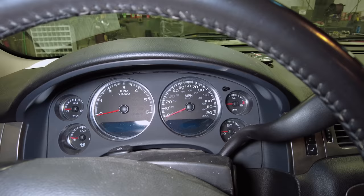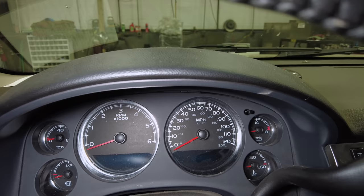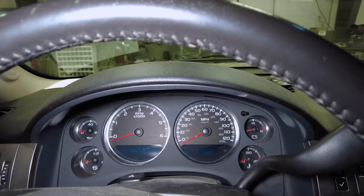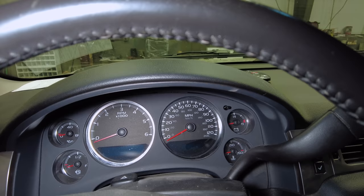We're just showing things that are going to fail — one of them is the instrument cluster gauges. These are so common to fail that there are actually mobile technicians who go around and fix them wherever you are. What happens is the little stepper motors that move the needles fail — your gauges read way out of whack, saying you're going 120 mph when you're not moving, or your voltage gauge quits working. The whole cluster has to come out and can be rebuilt fairly quickly.